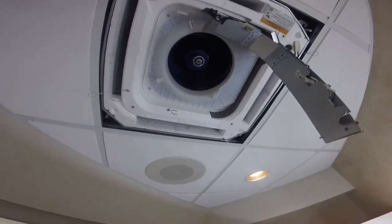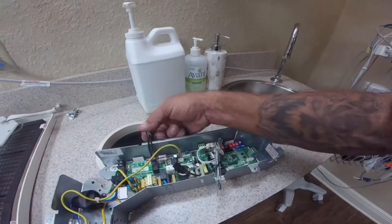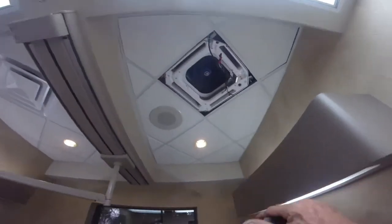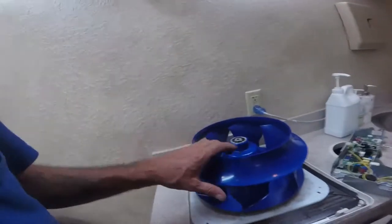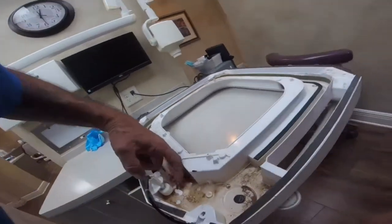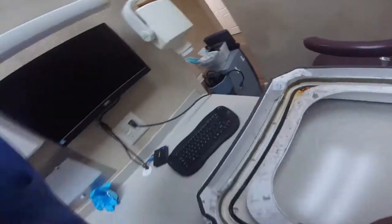I dropped all of this down — this plug here, this plug here, this plug here, and it just comes down. Now the next step is to drop the pan. I had to take the wheel down — I could have probably done it without that. Here's your drain pan, here's your float switch — that's what we disconnect from the board.